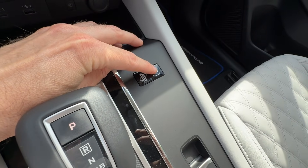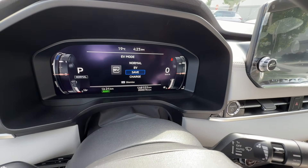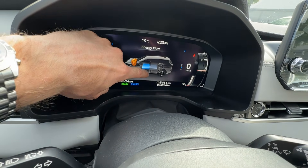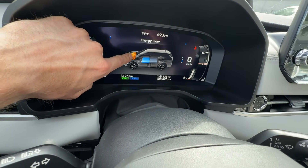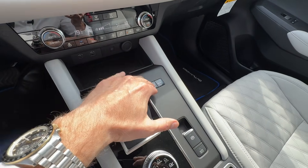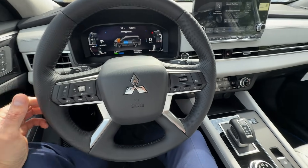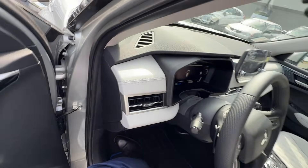You have this EV button right here — once you click it, it cycles through different battery and EV modes. Let's leave it on charge mode: you can see the engine has kicked in and the vehicle is now charging the battery. Since we already have some charge, it would take maybe another 40 minutes to reach 80 percent. This self-charge feature is very unique and standard on all PHEVs regardless of trim level.